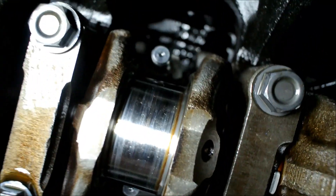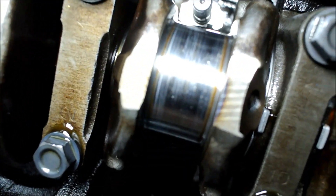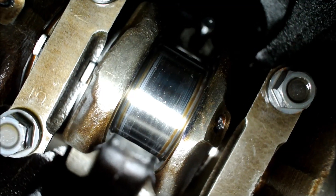Here's a look at the crankshaft journals. The camera was having quite a bit of trouble recording this properly because of the weird light and the oil sheen, but as you can see there is also some scoring and scratching on the crankshaft journals. This is very very bad and cannot be left as it is - the crankshaft needs to come out, which means the engine needs to come out, and the crankshaft needs to be ground away or replaced.